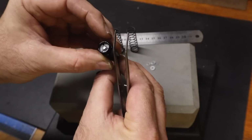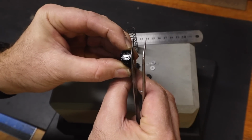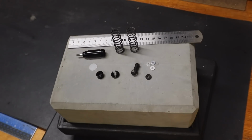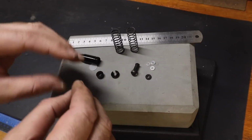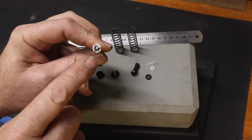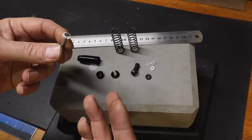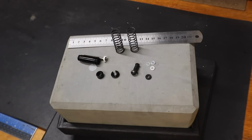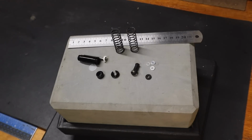and I can exhibit it better without seals. Whoop, whoop. There's a technical term for that in the industry, and it's called too much. Because that amount of space, and then we compound that by not using holes, but using slots, shock oil's not going to work. It's not going to work. Particularly with how stiff these springs are. To control that spring, to properly damp that spring, heavy is where you're going to have to go.